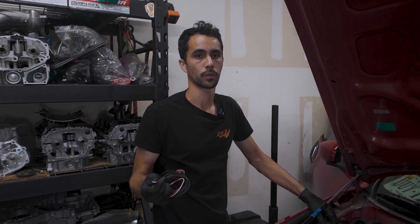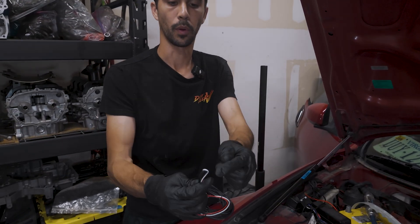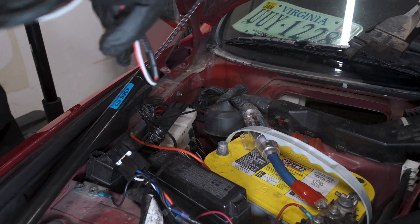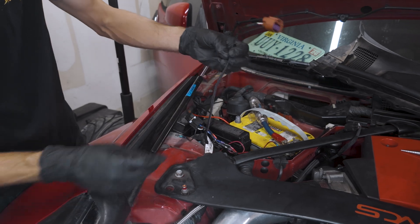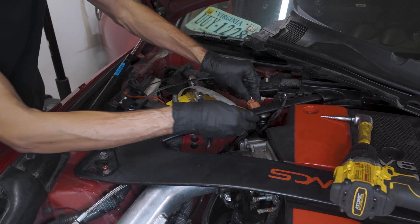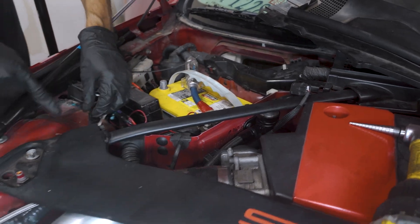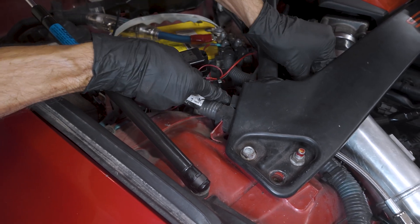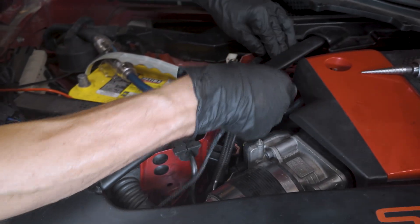This is how you wire in a flex fuel sensor for your 350Z, G37, or even Q50. Once you have your harness — the kits vary but a lot of the process stays the same — where the wires come out of the sheath, fold these over, then make a small hole in the rubber boot where the wiring harness goes through and push these wires through so they're dangling on the inside. The connector side — we're using our brand of flex fuel kit on our fuel return system, so the sensor is right here. Get this connector over into the area, push it in between the bar, pull the rubber boot up and split it, get the wires in between it, push it back down so it looks clean, then connect them in a clean fashion and tuck them away.